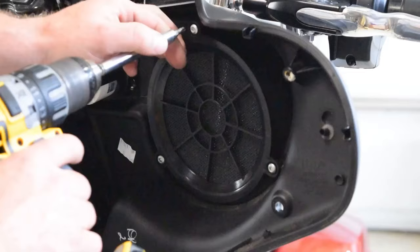Okay, so we're going to be cutting off these speaker leads from the factory location. I'm going to be using my wire cutters and crimper tool here. Just going to cut those off, and then we're going to use 16 to 14 gauge female connectors. We're going to add these to the ends of the wires and connect them onto the speaker here. Make a note, you do have positive and negative labeled terminals on the speaker. On these wires, I'm going to be using the black line as my negative and the regular pink one as my positive.